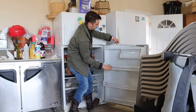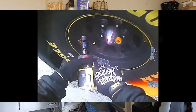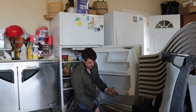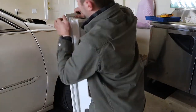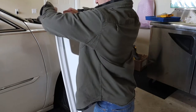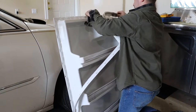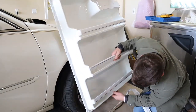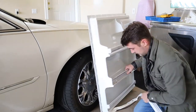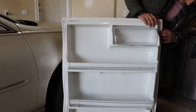On this particular fridge they're quarter-inch screws that also have a Phillips drive in the center, so you can use either a quarter-inch socket or a Phillips head screwdriver. Start zipping these out. Now we'll peel this seal off from around this door — carefully, not to shift this old plastic, and just be on the lookout for any of these screws that got stuck in the seal. For me there's about 10 of them.